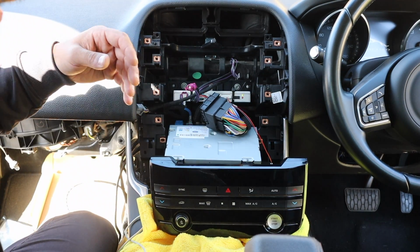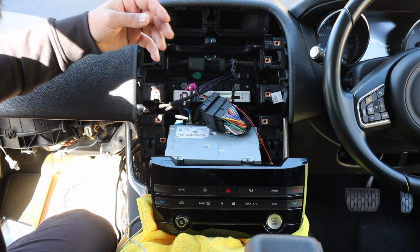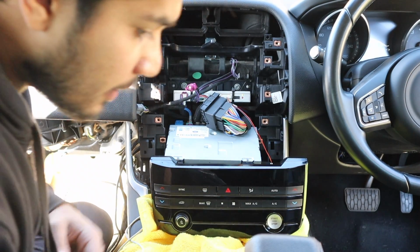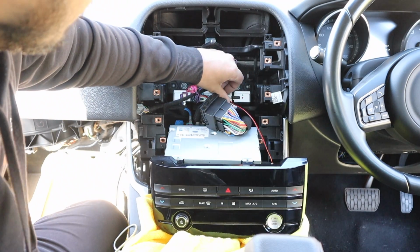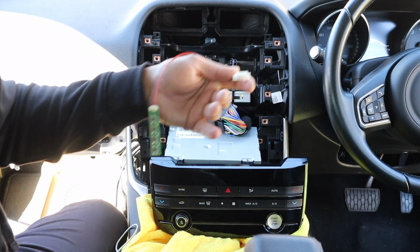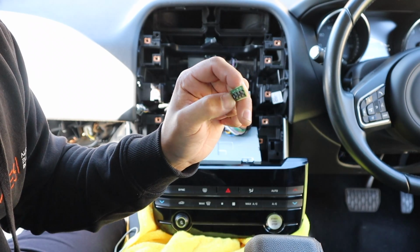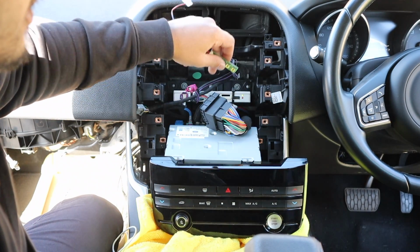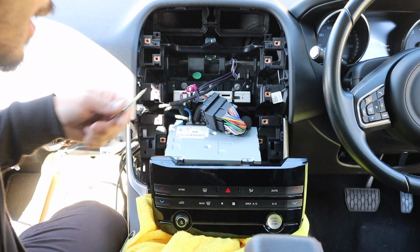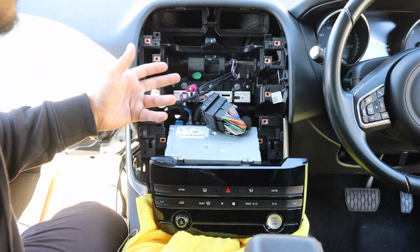what has to happen is, because there's more than just one CarPlay module, and there's different types, there's variables of everything, our little kit comes with this little 4-button system. You can go through the menu and change certain things. So I changed the dip switches, and we got it all working, but there was no touch screen. So we went into the menu and changed the navigation module to the right one, NetPlay, so it would work, okay?